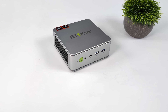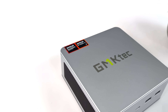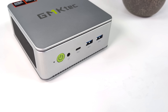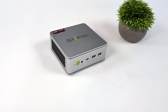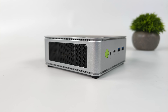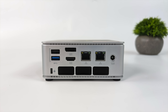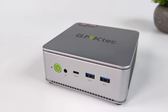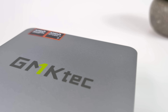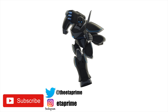So when it comes down to it, there's no doubt that the GMK Tech K8 with the Ryzen 7 8845HS is a great performer given that we're only working with an iGPU. These Hawkpoint chips aren't that far off from Phoenix Point — you're not going to see a giant leap in gaming performance since we have the same 780M iGPU. On the CPU side it does outperform Phoenix Point by a bit, but it might not be enough reason to upgrade if you already have a 7000 series. If you can get a Ryzen 8000 for the same price as Ryzen 7000, I'd go with 8000 for the newer chipset. That wraps up this first look at the GMK Tech K8 — more videos coming, including Linux testing. Let me know what else you want to see, and thanks for watching.